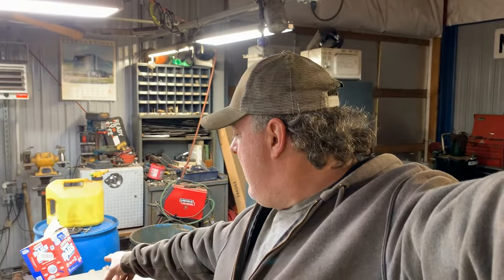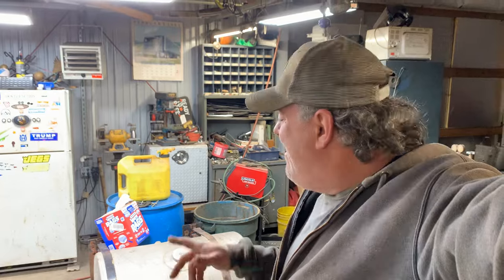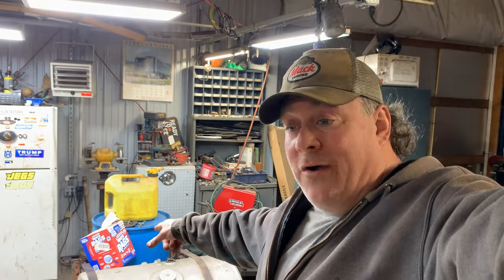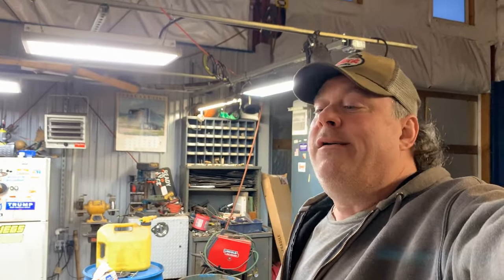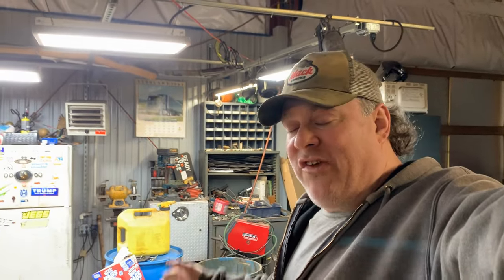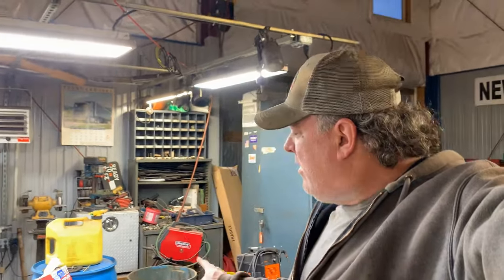I appreciate you guys watching my videos. Next week we're actually going to get some things on the truck — there's just prep work after prep work, and some things have to go in front of other things when assembling. Tomorrow I'm going to take these fuel tank brackets off the fuel tanks and put the tanks outside since we don't need them right now. Those brackets need to be sandblasted and primed, then they're ready to bolt to the frame. It's the cab bracket first, then the exhaust bracket, then the fuel tank bracket — they all have to be in order. I want all the metal on the chassis at one time when I spray color. Anyway, I appreciate you guys watching and sticking with me. Big Paul's out.